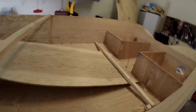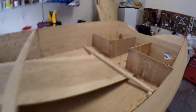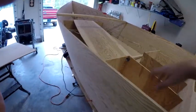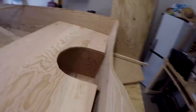A couple of issues though — these angles are just killing me. Here's the sole, the floorboard, and it overhangs the forward bulkhead; I don't know how to fix that since the forward bulkhead can't go up further without cutting it. Other issues are gaps here, here, and here, and up in the forward bulkhead. I can't help but think the angle of the sides of the boat is incorrect, and that's causing the floor to be out of alignment as well.